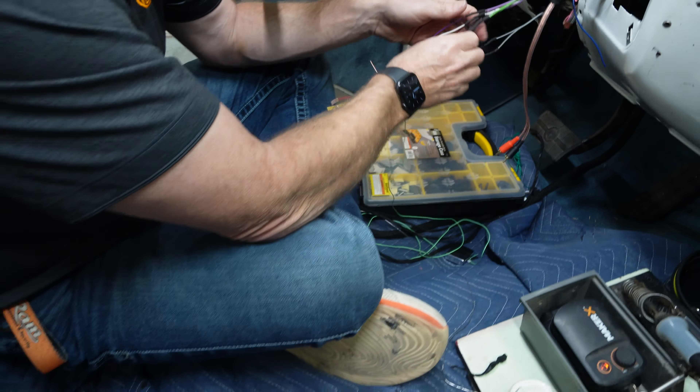It's way more organized than I would have done. The wiring is an art form. So I'm separating out my rear leads — I'm just going to flip these that aren't being used out. So now I can check my ground and switched. And I have a good 12 volts keyed on and a good ground.